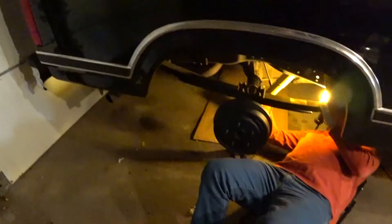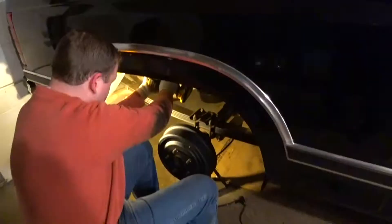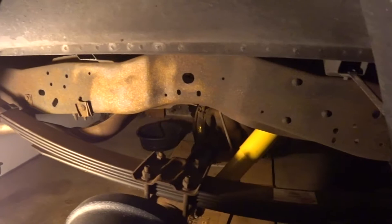What John is doing right now is taking a wire brush to the front part of that diff right there, just to loosen up some of the rust and debris that might be on there. He's gonna prep it for paint and throw on a nice coat of rust protection paint over that. Now John is working on cleaning the frame up a little bit as well — we're going to hit that area as soon as he's done, little by little cleaning this truck up real good.